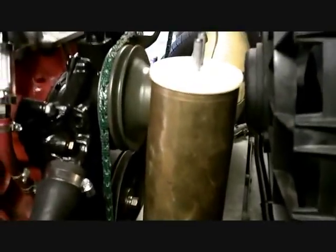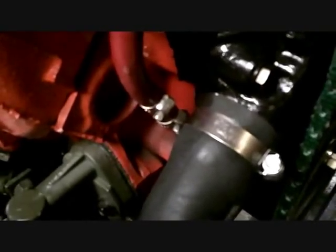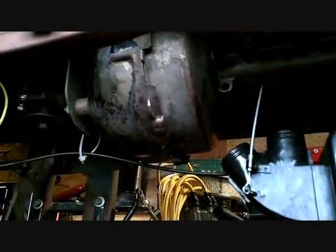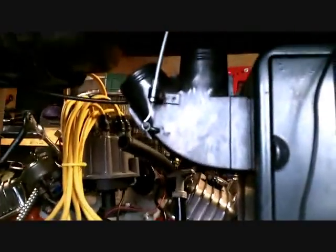Look at how shiny the pulley is — I hit it by mistake. Works good on brass too, just cleaning that up, it's kind of dingy. The pulley, oh my god. I don't know if you noticed in the video before — I put a little finger full of grease around the inside of the boot. That's an old race car trick — that way if you had to pull a hose off to change it, you know how they bond to the steel after the heat hits them — it won't do that as much. The brake booster is in. Master cylinder is in. The brake lines are not connected — the rubber hoses are still there for bleeding. The Allison's probably next, and the alternator. Dear god, never ends — it'll end soon.